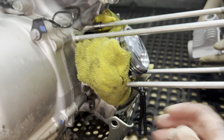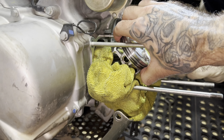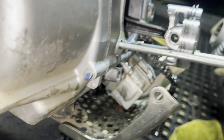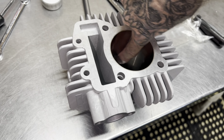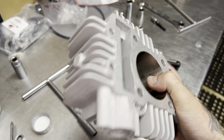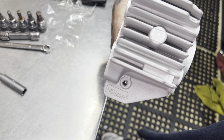Now we're going to clean off the base gasket. Don't want to damage the piston — pull that thing out of there, don't want the piston smashing off the thing. Keep her nice and mint. Give her a little shot of brake cleaner — nice and cleaned off. There's the cylinder right there ready to go on. So here's the cylinder — put a little bit of oil on my finger and just rub it on in here. Nothing crazy, you don't need a lot. There's the TB part cylinder — it's marked 143. 143 on the cylinder.